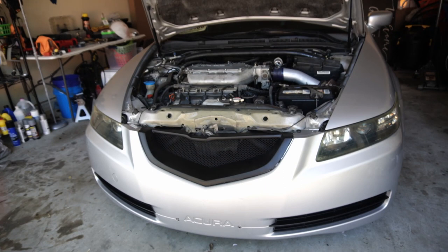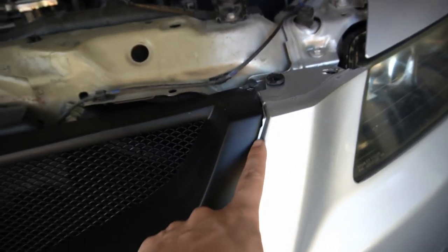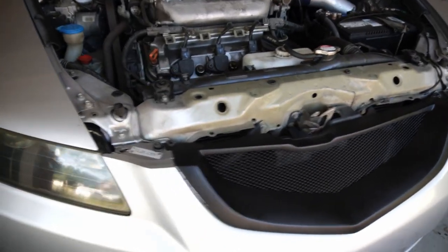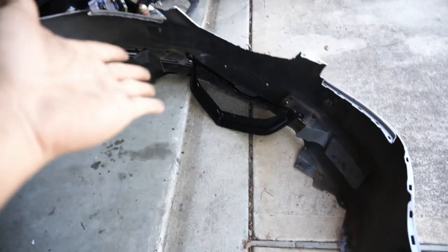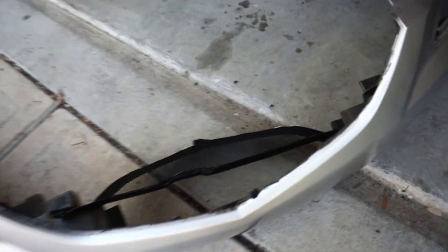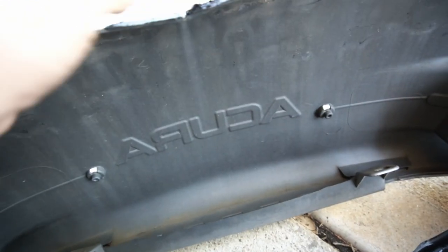This is the problem right now with the grill — you can see there are still some pretty big gaps along the line at the edges. So first let's go ahead and take off the bumper again and see what we got. I took out the bumper. I added some butyl right here to secure it a little bit, but not all the way. There's some residue from that.